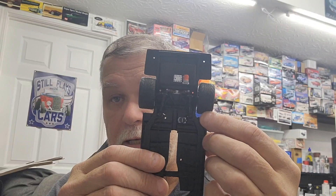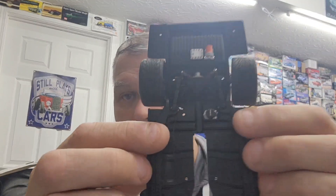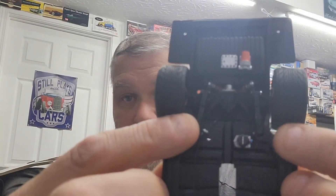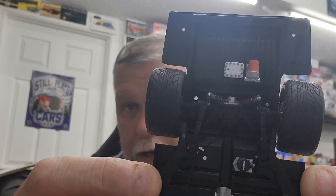Hope you guys enjoyed this. Let me know what you think about it. Remember, we wanted to work with the kit — it was easy to add aftermarket stuff, but I wanted to try something new and this was for Jay. So we scale-narrowed the rear frame rails by four inches. We cut them out, removed all the material, moved them in, put them back, fit everything in, sanded smooth, filled it in, sanded it, to give that OEM look. We modified the four link from factory to give it more of an aftermarket look.